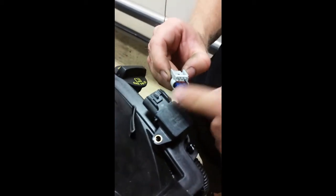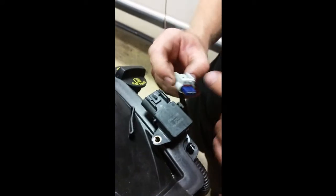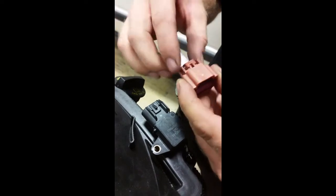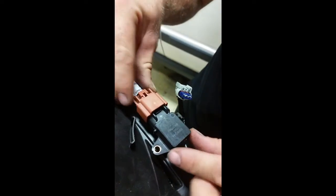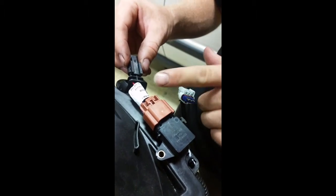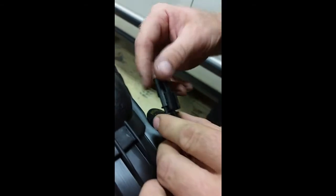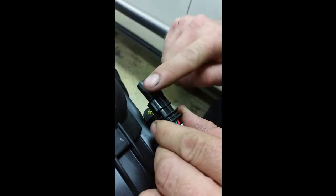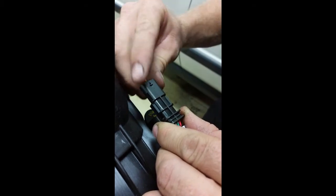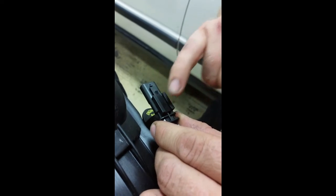These connectors are different. This was the Dodge style; this is more the Mercedes-Benz micro-type connector. This portion here goes to the map sensor, of course — you'll push on very simply. The color of the wires is not relevant at all; it doesn't matter what color the wires are. What matters is it has two sides. The top side is the careful part here — the top side is smooth, with one tab.